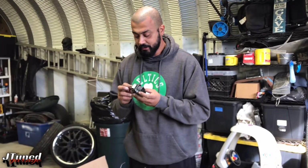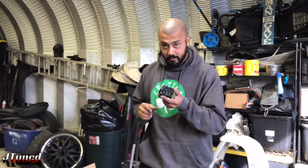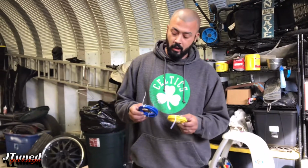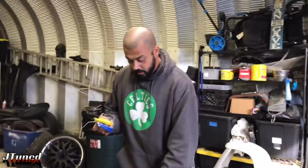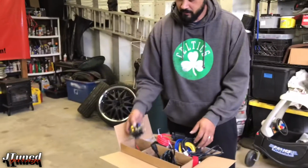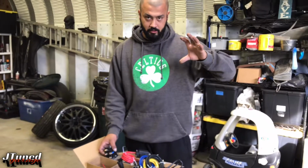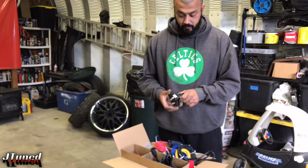So what I'm gonna do different this time that I didn't do the last time is after I have everything mounted in it, I'm gonna weatherproof it, because the last winch I had, all these wires corroded to shit. All corroded, ground wire, power wires, all these wires corroded. And then this was all rusted up. It was garbage. One day I went to use it and it just stopped and that's it. So I'm gonna weatherproof the hell out of these when I get it installed.